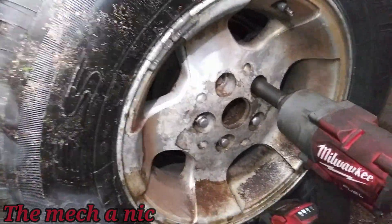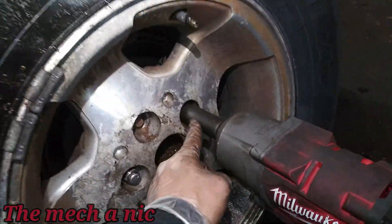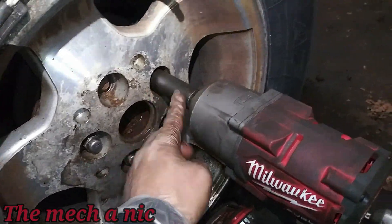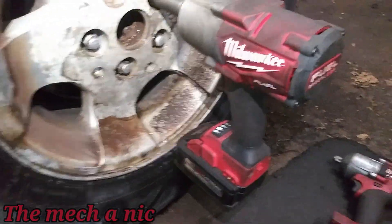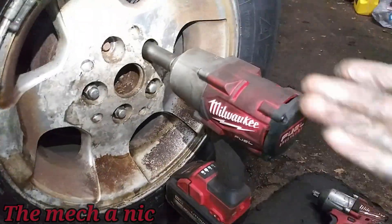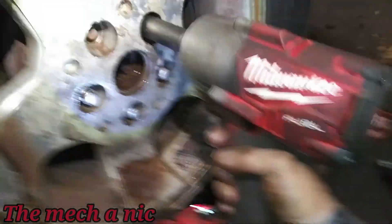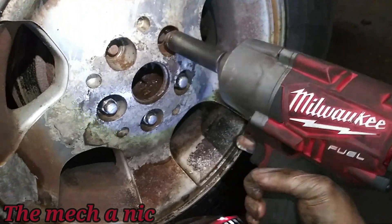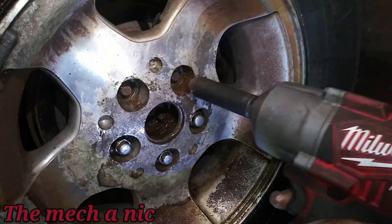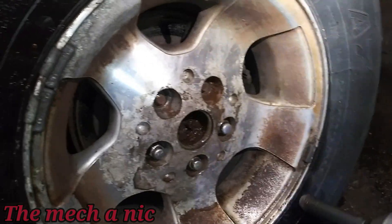I don't think I'm going to be able to get done — I can't get this wheel off. They're seized down. One of the lug nuts had its cap fall off, so it's no longer a 19mm; I was able to hit it with an 18mm socket. I've got this thing on full beans with the big gun — it was like 1,300 foot-pounds. Then it just made a liar out of me because I was wailing on it and it wouldn't budge, and then boom, turn on the camera and it comes off.